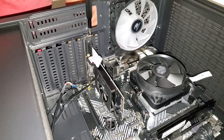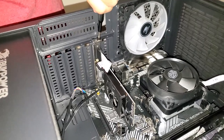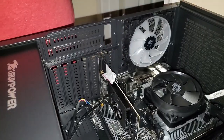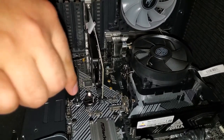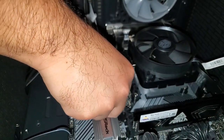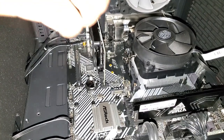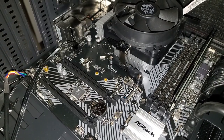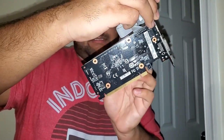I'm going to unscrew this — it's screwed in tightly. That way it should open the little bracket. And I think there's a little lock on the PCIe slot. I'm going to open this and we're going to remove it. Okay, it's out. So as you can see, I got the graphics card removed. All right, now it's time to plug in the new one.